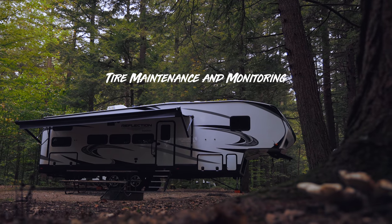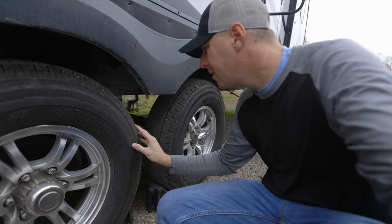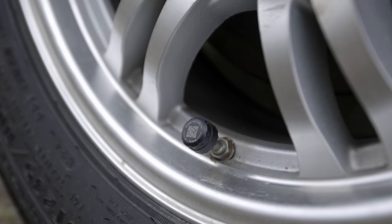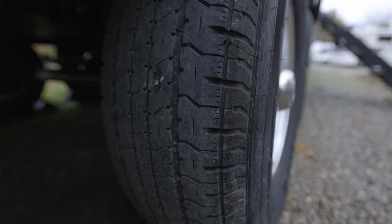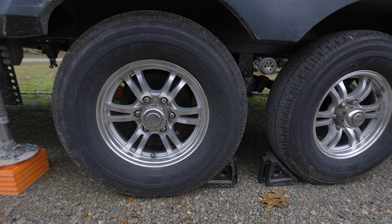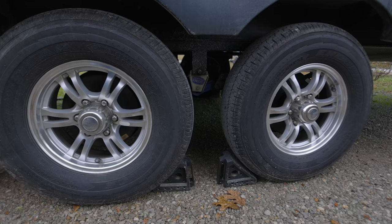We do the maintenance on that all the time — more than twice as often as they would probably recommend. The other thing I want working properly is number five: the tires. I keep a close eye on the tires, visually inspecting them all the time, taking a quick glance before we tow. I check the tire pressure, and having a tire pressure monitor system helps — you turn it on, see the pressure and temperature while you're driving. In the visual inspection I look at the tread to see how it's wearing, which tells me if there's any additional problem with the axle or the way it's going down the road. We have a whole video about tire maintenance, but this is really high on my top five list. Because if you blow a tire, there's significant damage that can happen to the outside of your RV and the axles. Anything I can do in preventative maintenance to stop that from happening, I'm absolutely going to do.